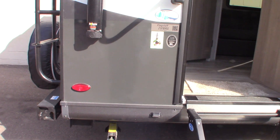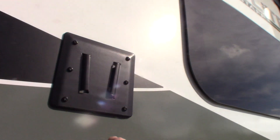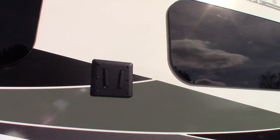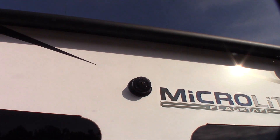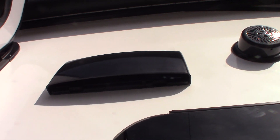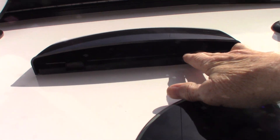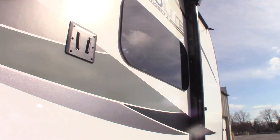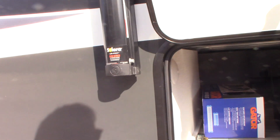You have crankdown stabilizers, a power awning with LED strip, a TV signal out plus power, plus a bracket to hang the TV on — you get the other half with it too, so you can put it on the back of the TV if you choose. You've got outside speakers. This is the range hood vent here. When you're running the range hood to vent to the outside, make sure the baffle in there is flapping freely like that, otherwise it won't make it to the outside. Always make sure when you're traveling, you can just clip that shut.